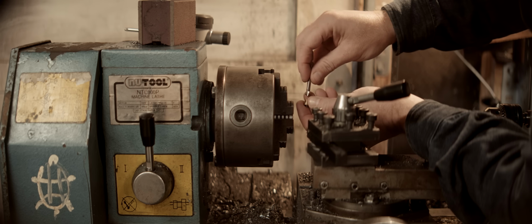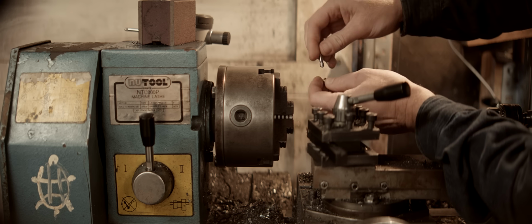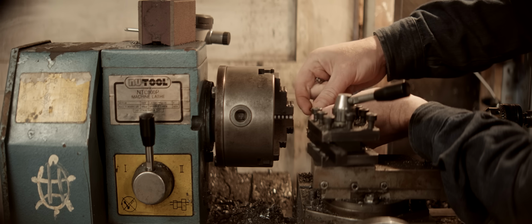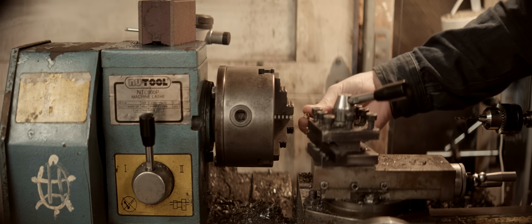If so, we'll have to modify that needle a little bit. And I am deburring the jets after drilling. I know it's not the most accurate way of sizing a jet, but it's accurate enough for this fuel. It's not as finicky as gas.